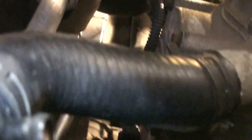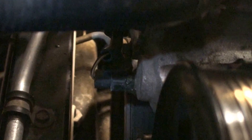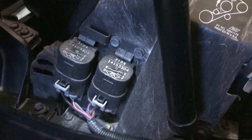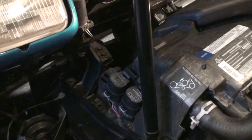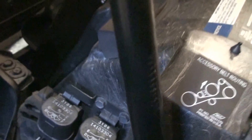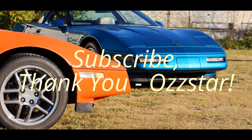I think that's pretty much it for the engine sensors. There's a coolant sensor around there — it's kind of hard to see, right down in there. And people always look for the fan relays for the cooling system — these are your two fans for the primary and auxiliary fans. They're located on the driver's side of the radiator above the air pump, right here, if you ever need to diagnose those.